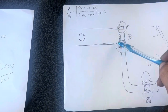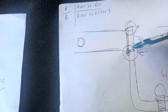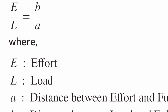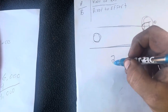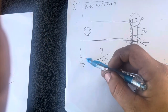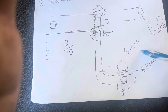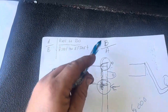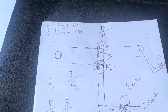Let's use a 10-inch drop with a ball as an example. To calculate the lever, you need B over A: pivot-to-resistance over pivot-to-effort. With a 10-inch drop, it's 10 over 2, which simplifies to a 5-to-1 lever ratio. So whatever force you're putting at the ball is being multiplied by 5 at the weld point. If you're putting 6,000 pounds of force on the ball — within the rating — you're putting 30,000 pounds of twisting force at that weld.